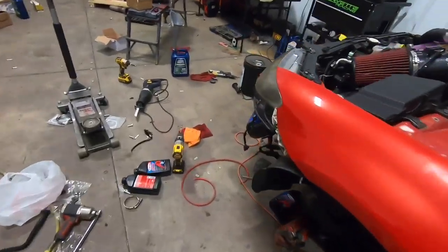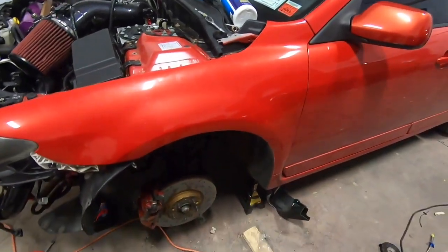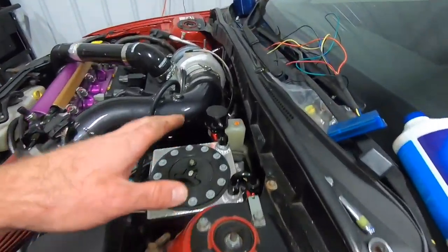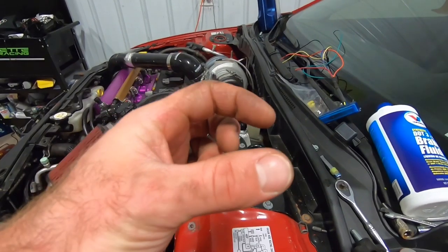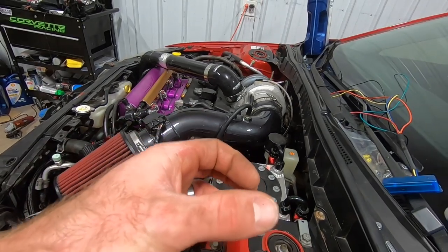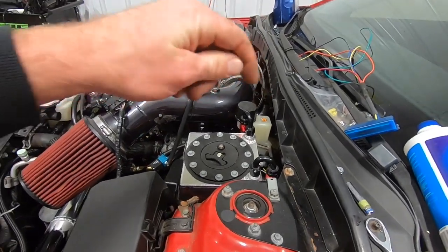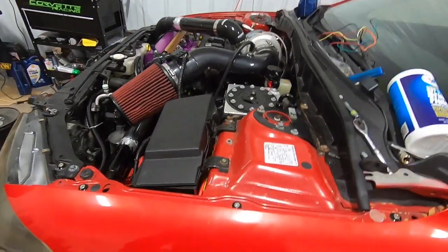We just got done bleeding the brakes and the clutch. Now, for those of you who don't know, you can find yourself very frustrated really fast if you don't know this. When all the lines are out and draining, when you take a motor out or whatever, all the fluid for the clutch drains out. The clutch shares the same reservoir as the brake, and you'll notice there's a max line. But when you open that, there's a little slit at the top of the ring when you pour fluid in. It's right in this area. Basically, you have to overfill the brake reservoir to allow fluid to go into a separate chamber for the clutch line. And you have to rebuild all the pressure in the clutch lines and then bleed the clutch as well.